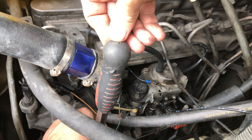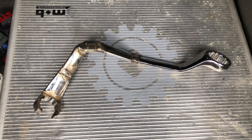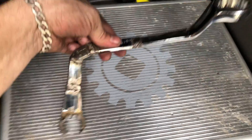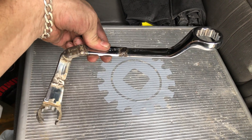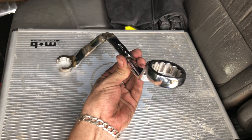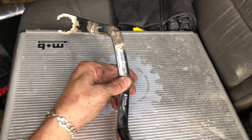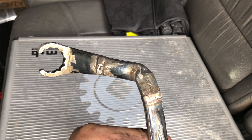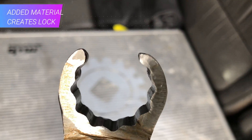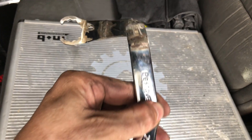I'm just locking the idle screw because the engine idle right now is basically being controlled by the fuel load screw, so the actual idle adjustment really isn't doing anything right now. If anybody needs one of these sent to them just let me know — the welds are stainless, not the most beautiful thing in the world, but that is exactly what you need to get the start-stop solenoid out and back in again. It's 24 millimeter, and then this has been modified too — we welded on some extra material to wrap around it because when it was more open it would kind of slip off. There you go.